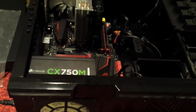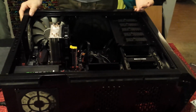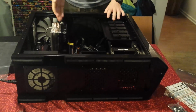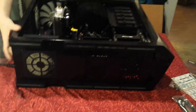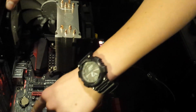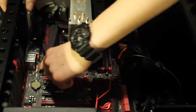And that says, okay, it ran, the motherboard and processor ran through power on self-test, which basically just means, okay, I recognize that I'm a processor, I'm in a motherboard, I have RAM, I have a cooler, I have power, everything's good. Alright, so if you come here, I'm going to turn on my power supply, switch on the back, boom, stuff lights up. Pretty nice. Some lighting effects along the Supreme FX, that's the audio.